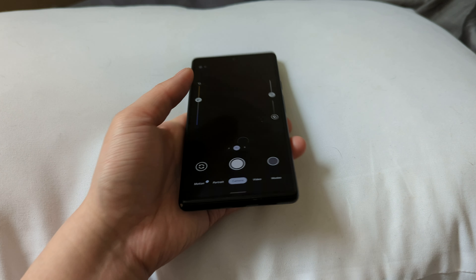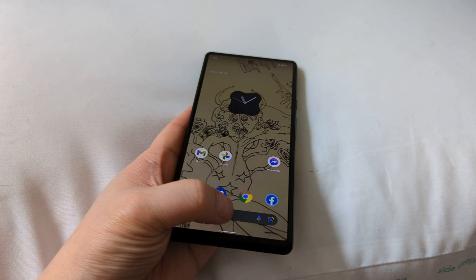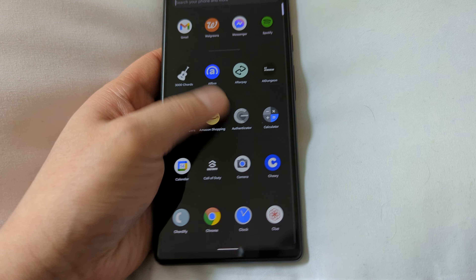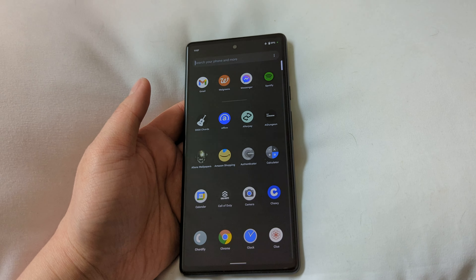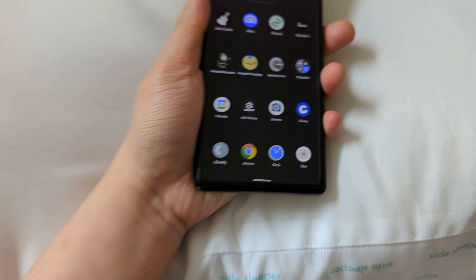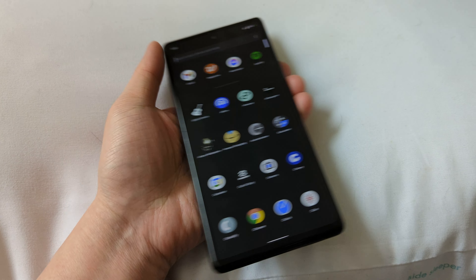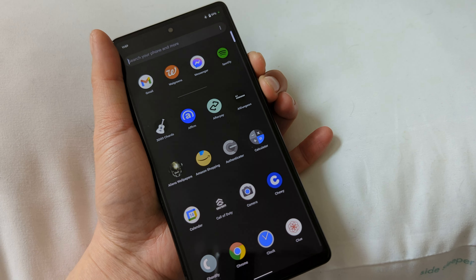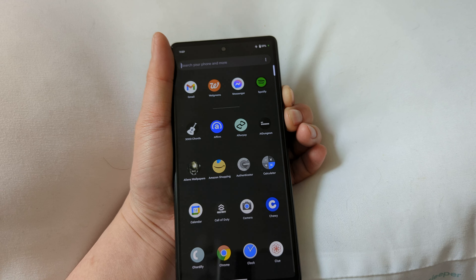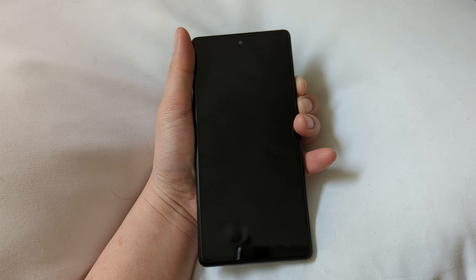The camera's not even working anymore. There's nothing in the photos, it just locks up, and once you get out of it it looks like it's still running — but now it won't even scroll. Eventually you get System UI unresponsive messages, and it's warming up really, really quick. There's nothing you can do. The only thing you can do is push and hold the power button and the volume up button to force it to reboot or shut down.